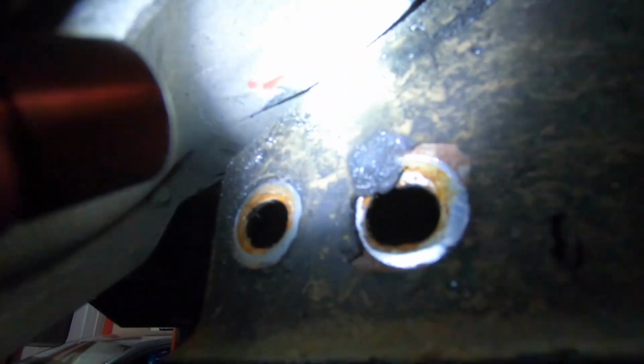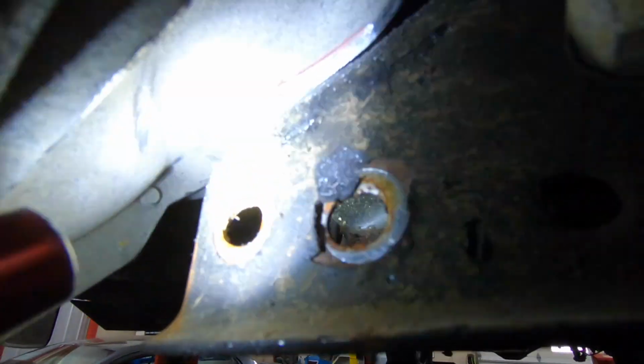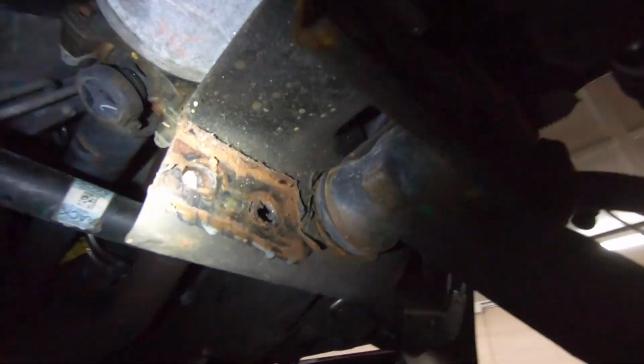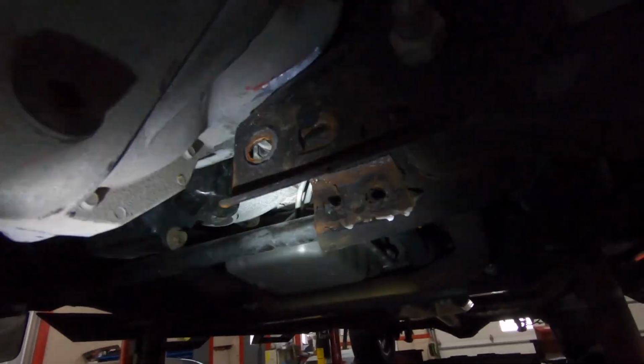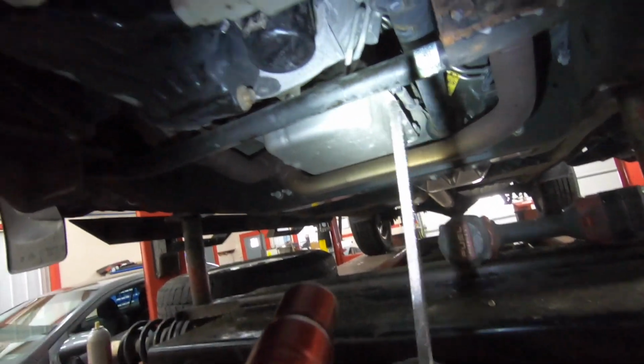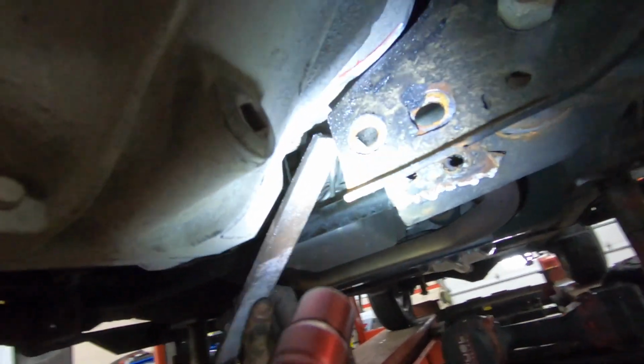And then what you're going to want to do is come in here and grind this off on these 2 cooling fins right here that come right next to the frame there. What I did was I jacked it up, and of course you can't get anything in there to grind it. So I actually used a file, slow boat to China, and I just went in there back and forth like this on it.